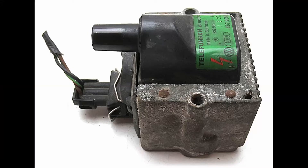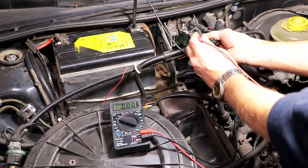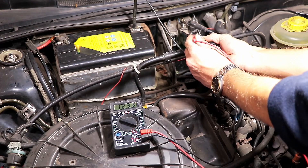Owners of the Volkswagen Golf 3 or Passat can ask what they should do, because on these vehicles there is a square ignition coil where the power supply lead and switching lead are not accessible since it has an integrated ignition amplifier. This is not a problem at all. All we need to find the correct wire is to remove the three-pin connector from the ignition amplifier. Switch the ignition to the on position and check with a multimeter each pin of this connector. Only on one pin will we see 12 volts, and this is exactly the wire to use as power supply for our TPS sensor.